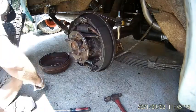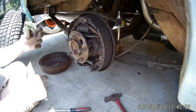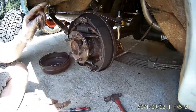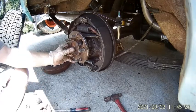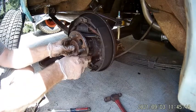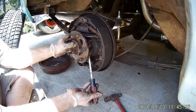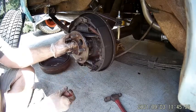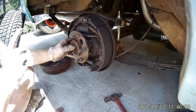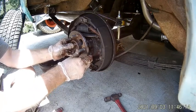My whole issue this whole time was that as you adjust and tap the adjuster, it pushes on the center puck. Those thrust buttons go into the puck, and as you push this side it pushes the other bearing into its race and takes up the slack. I just proved that because this was loose and I had play here and over there, and I tightened the adjuster up and now I have no play over there and almost zero play here. I'm going to back it off just a little. I'm very close to adjustment - I can feel it moving about five thousandths.